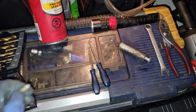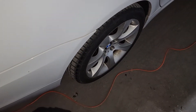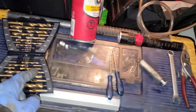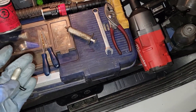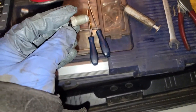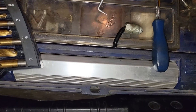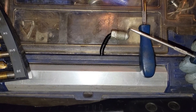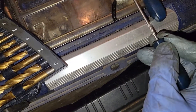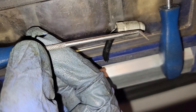Just a quick note. I had to do it quickly because the bleeder valve, when you remove it, just because of gravity, fluid would start to drip out from the area. So I had to improvise — I basically used one of these gloves, wrapped it around and just shoved it in the area to stop the leak while I was fixing the bleeder. There's a hole at the bottom of the bleeder and a hole where you plug in the hose to bleed the line. So imagine a 90-degree turn — a hole inside the bleeder valve that meets with the line that exits through the side.